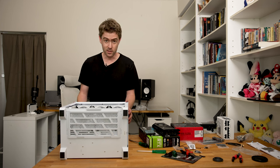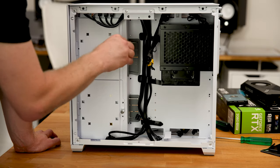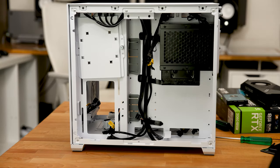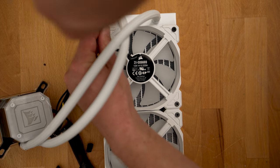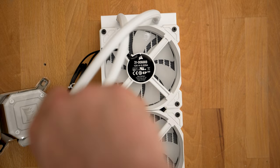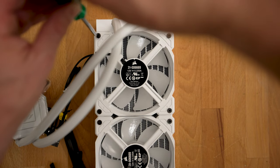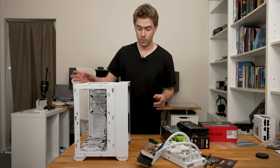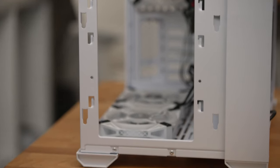The next thing now that the motherboard is in is to install the CPU cooler. Here we have the Corsair H100i Elite Capellix all-in-one cooler in white. First thing we're going to do since we're mounting this cooler on this side is remove the side panels. Make sure you use the super long screws that come with the all-in-one to secure the fans to the radiator for a super tight fit. I'm going to be mounting these fans as intakes, but you can also do exhaust — the case manufacturer recommends exhaust, the cooler manufacturer recommends intakes, so try both and see which gets you better temps. Note: I've had to remove the two front fans and the top fan to get this all-in-one in, so you may be better off doing this when you first start the build.